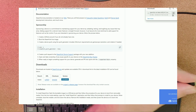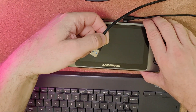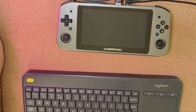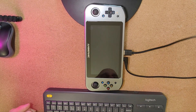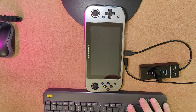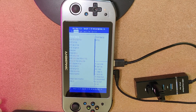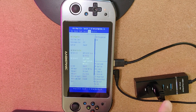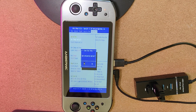Then plug in your keyboard adapter, or your keyboard if you're using a wired one. Plug in your USB memory stick and power on, being ready to press the Delete key to get into the BIOS setup. From here, once you've got your stick in there, go along to Boot. You'll see it's defaulting to the SSD built into it — the M.2 drive. The second boot option is the Corsair memory card. Change that boot order around, then save and exit and let it restart.